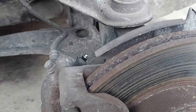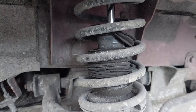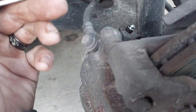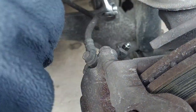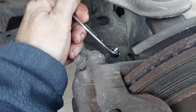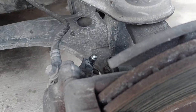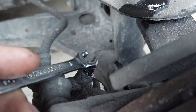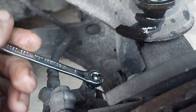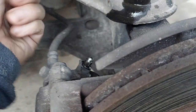So if you've never done the two-man bleeding method: you open up the bleeder — this one is a little sticky, first time it's been opened in a long time — and then you call out 'down' to your helper. The other person pumps the pedal all the way to the floor, then reports back that their foot is on the floor. You need to close the bleeder before they let their foot up, because if they lift with the bleeder open it will suck air into the brake system — a major no-no. Once the bleeder is closed, you say 'up,' which lets your helper know they can raise their foot and let the pedal come all the way back up.